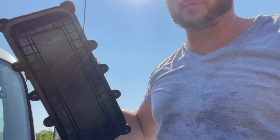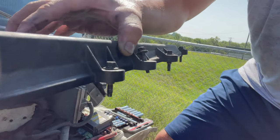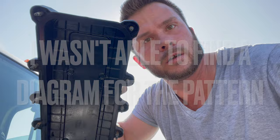Full disclosure — I did not end up going in and washing it. I used a shop rag and really tried to dig in there. You can see there's still a little bit of residue, but it's got a new filter, it's going to be just fine. You should follow whatever Cummins recommendations are, but this is what I'm doing. Make sure all the bolts are back in, sit the cover on here, hand tighten it a little bit, then get them snug based on the pattern they tell you to do. I'll post the link in the description, and if I can get a snapshot, I'll put a picture here for the torquing order.